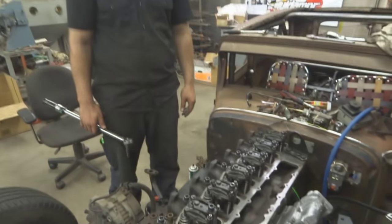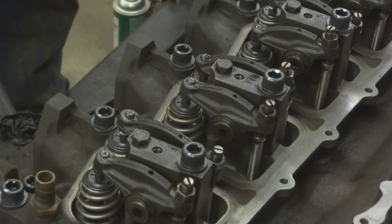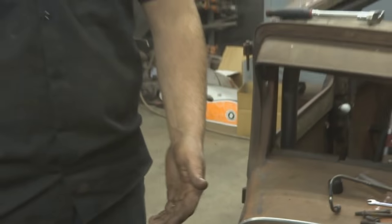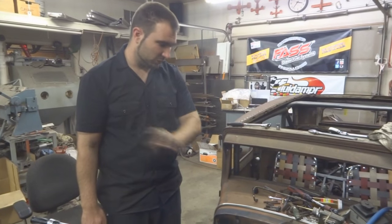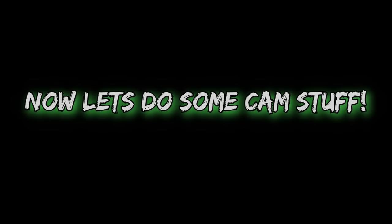Otherwise, what I prefer to do, especially if we're going through the motor completely, is send it to the machine shop and we just open it up to 14 mil, and then we don't have to spend $1,000 on a set of studs. We can just spend less than $200 on a set of bigger bolts that, because they're beefier, will actually hold more than any crazy 12 millimeter alloy could ever dream of. And they're not as brittle.